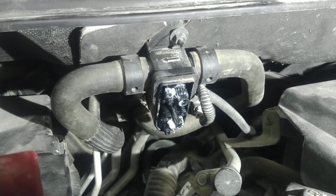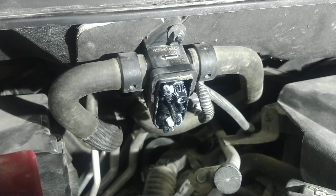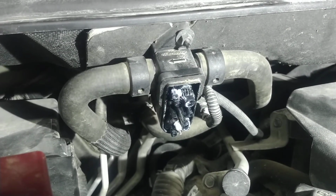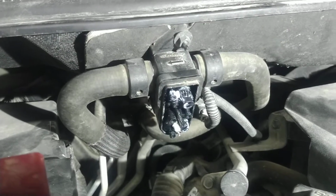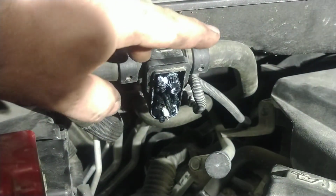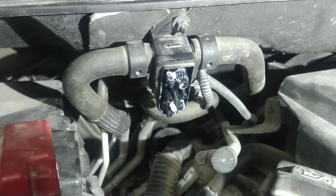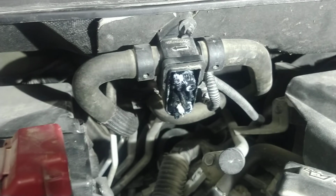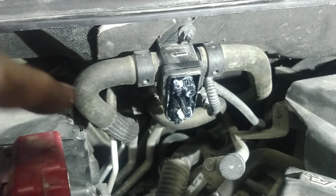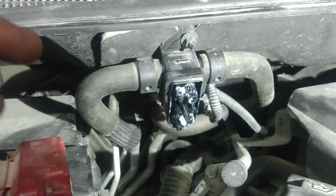What they use that for is to shut the heat off going inside when you have the max air on. Well, at some point, it has failed. They used to be a vacuum operated apparatus, where they ran a vacuum hose through the firewall out here to it, and it had a little valve. Well, now this is better, because that assembly I've put on maybe 3 times in 30 years. That thing there is going to be fun. Now, it had screws in it.